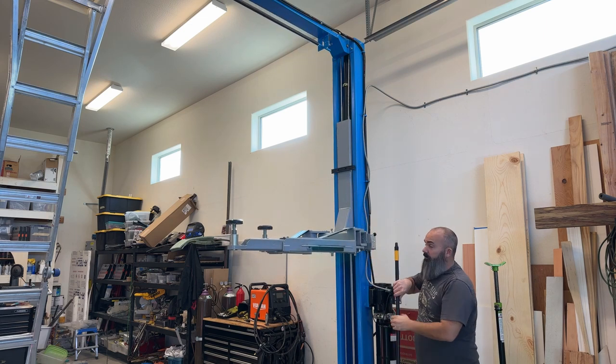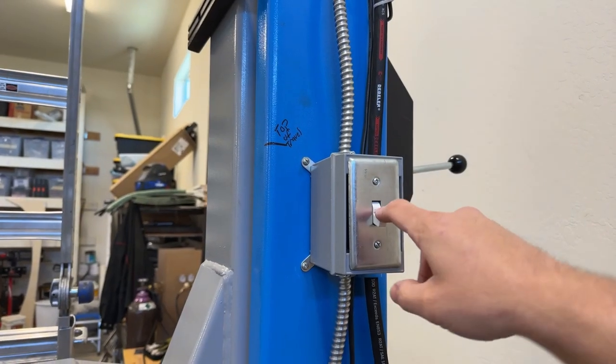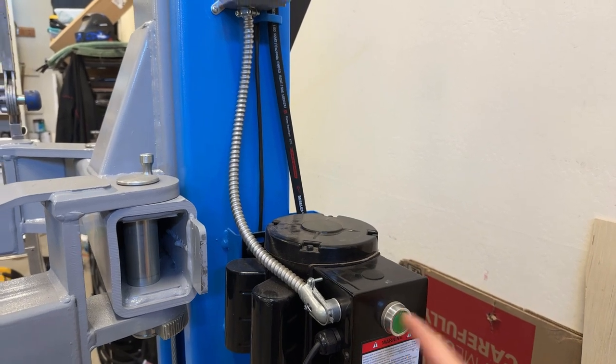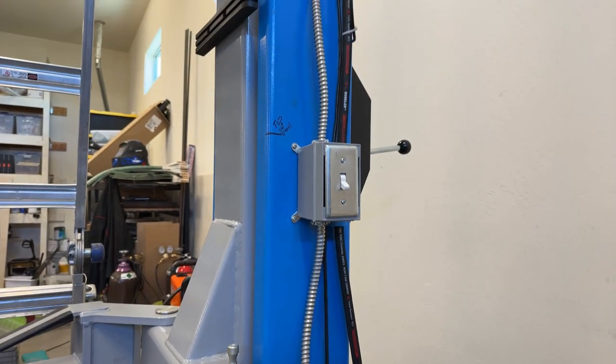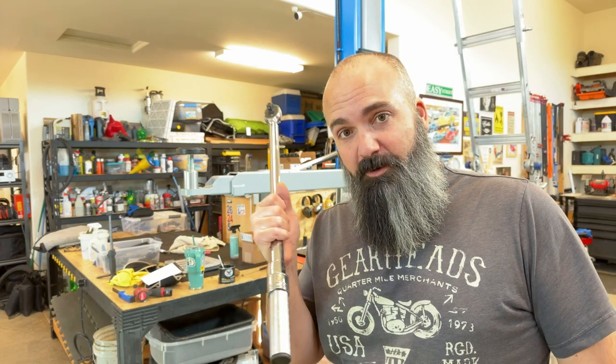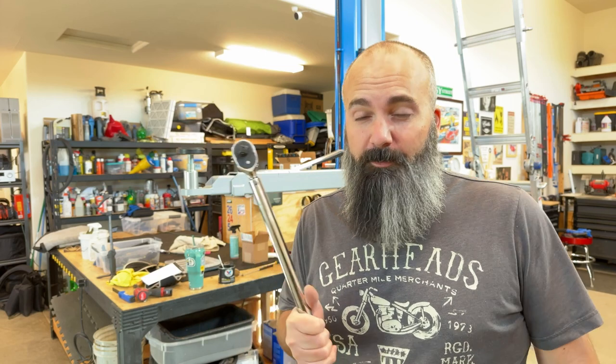That works nicely. While you're checking switches, I also have an emergency cutoff here — that way if something were to short out while I'm right there, I can easily pull this switch since my breaker is outside. While you have the lift arms up out of the way, take your torque wrench. Depending on the bolt size you have in your concrete, 90 to 100 foot-pounds is what mine's rated for — double check that your anchors are torqued down too. Those are probably some of the more important bolts on the whole setup because you don't want this falling over or ripping out of your concrete.